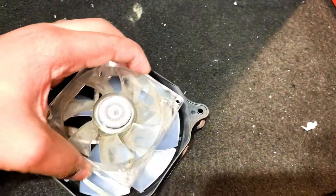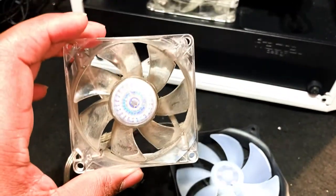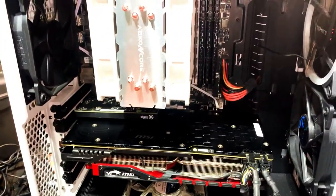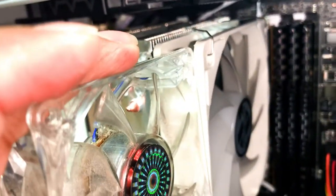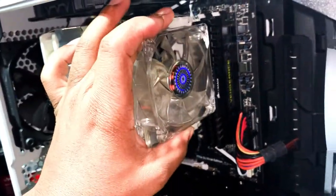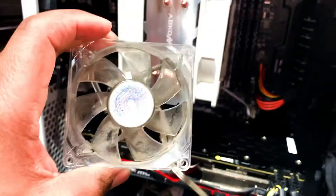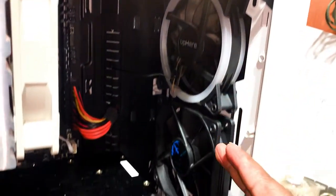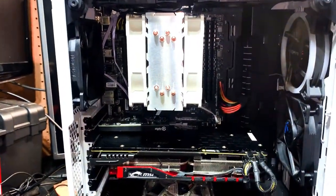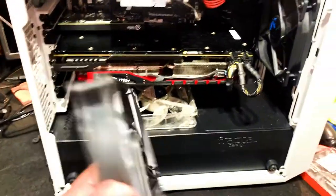Let's put this fan over the other one and just look at it. This type of small fan — it's going to be a task to cool those components. Just look how small this is matched up against the 120. Imagine trying to cool an eight-core CPU with something that size — it's really hard to functionally cool your computer case. That's the short story of why you see a lot of 120-size fans being recommended.